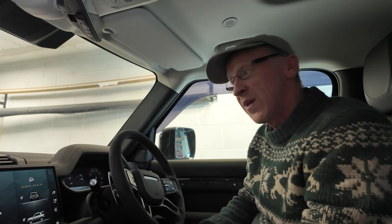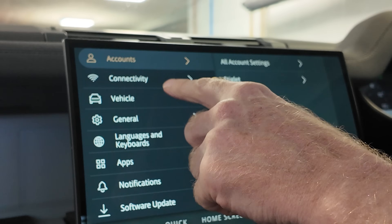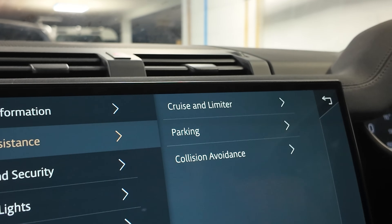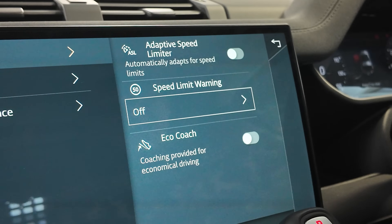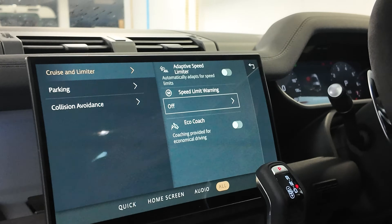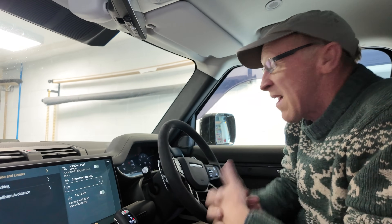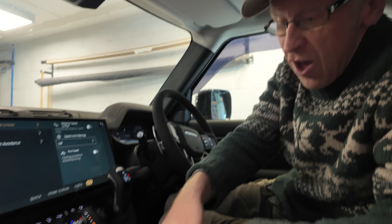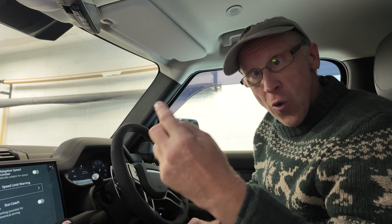How do you know if you've got adaptive cruise control on your car? You can go into the menu — go to vehicle, then driver assistance, then cruise and limiter. Note that adaptive speed is not the same as adaptive cruise control — that just limits speed depending on the speed limit in your area. If you have adaptive cruise control, you'll have a menu here that says 'stop gap' where you can set it near or far. We haven't got that menu, so I know we haven't got adaptive cruise control.